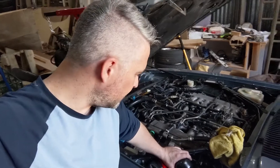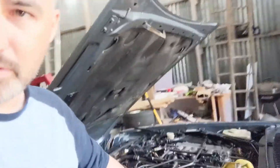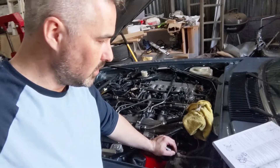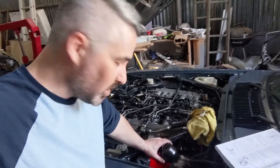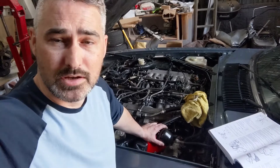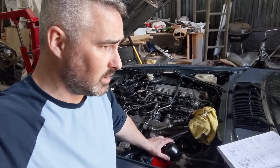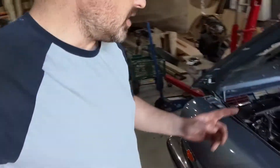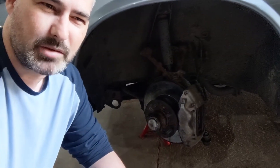This is kind of frustrating — the whole pump assembly moves, and with an 8mm Allen key socket in the ratchet with as much torque as I dare, it's just bending the mount. I don't think I'm going to be able to get this off without calling my dad to come over — he holds the motor body still while I apply the torque, or vice versa. Either way, frustratingly it's not coming off tonight. Better that than getting it apart and not being able to put it back together. I've taken the wheel off — I posted a short video about this, I think just on Facebook.